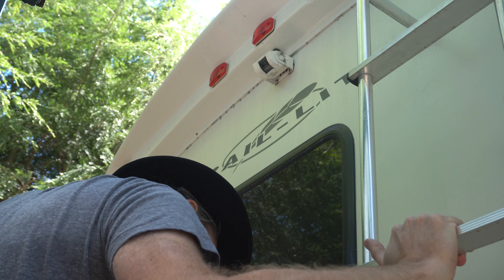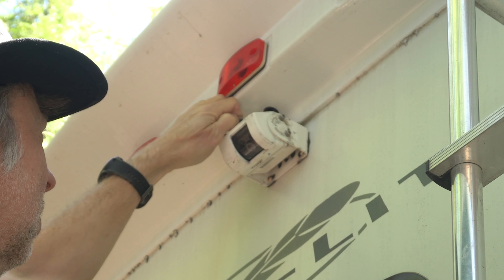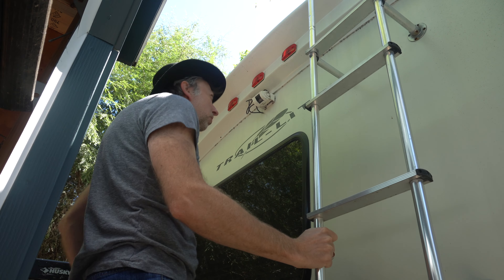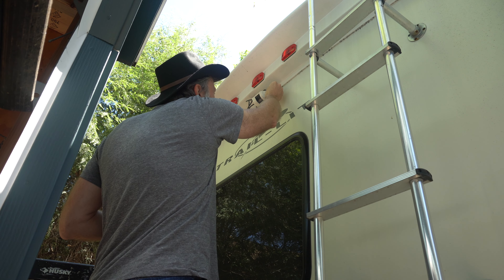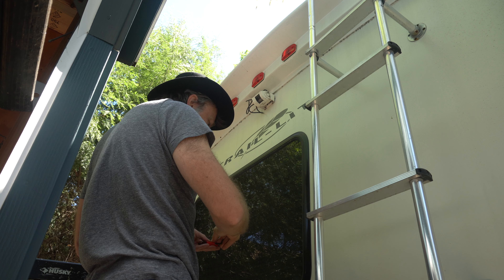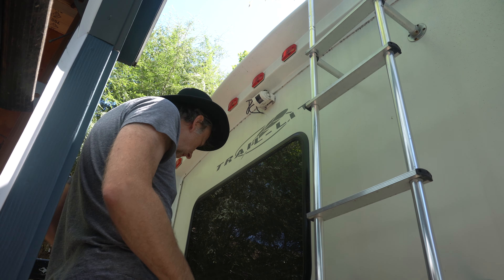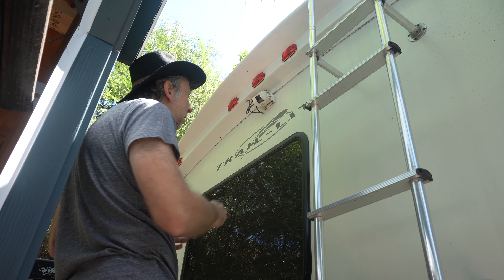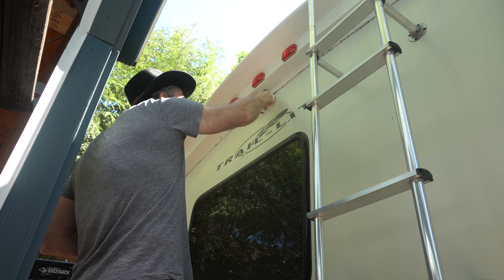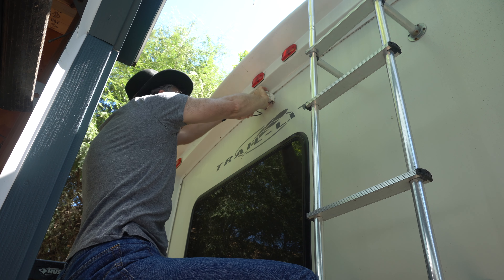We're at the back of the RV. It's got the existing camera right up here — this one we want to remove — and then I'm going to try to find that power source via this wire. I feel like I'm about to lose this plug. I just double checked inside to see if the camera sort of magically started working, but that's not the case. That's 1/8th — let's try 7/64ths. That's a bummer, must be some weird European size. Plan B — life lesson here: the best tool for the job is the one that's perfect for the job, but the second best is the tool that will get the job done. In this case it happens to be these little pliers.